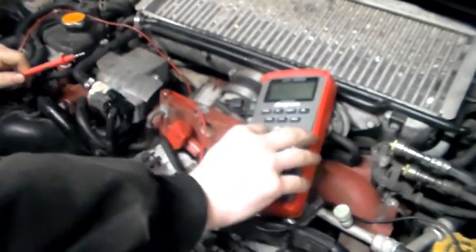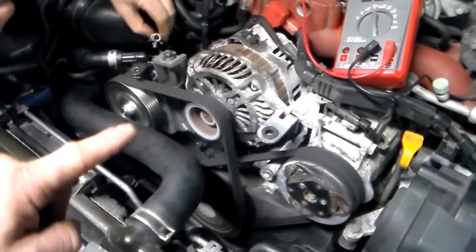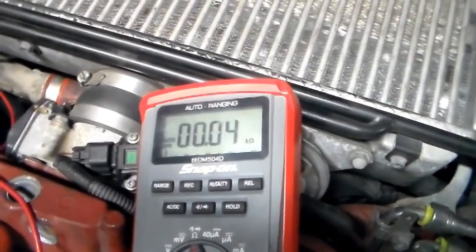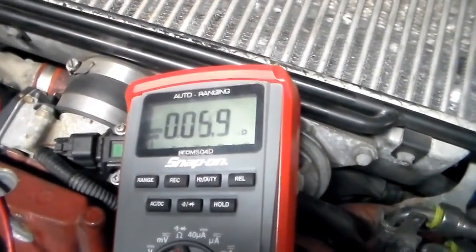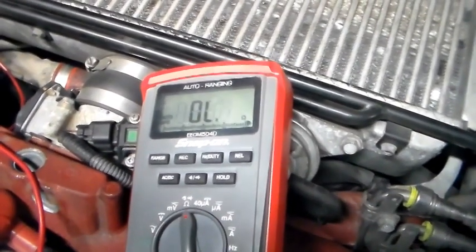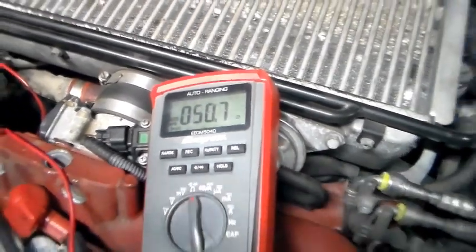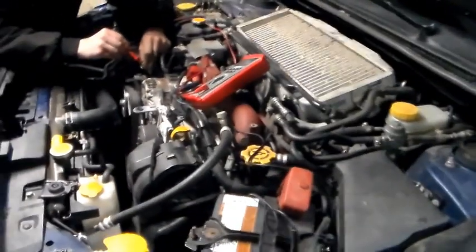Okay, start it up. Got all the wires clear. Make sure your probes are clear of the belt and everything before you have them start it up. He's holding one test probe on there — go ahead and turn the wheel. And see, we're kind of jumping all over here at 66, going to OL. He is not moving the probes at all; the probe is steadily on the sensor wire, and we are definitely getting a high reading. He's just in there turning the wheel one direction to the other, back and forth, as the other guy is holding the probe.